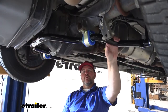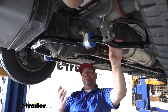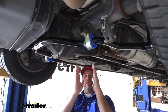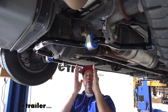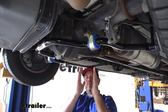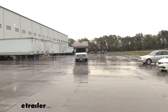Upgrading your rear sway bar is going to enhance your driving ability and make your ride a lot more comfortable. With our factory one on, what happens is our motorhomes sit so high — when you're passing a truck trailer and you get a crosswind, the top of the motorhome wants to lean. The higher or thicker we go with our sway bar, it's going to reduce the amount of movement the top of our RV gets and make the steering a lot better because we're not going to be fighting to keep it on the road.